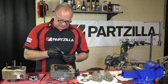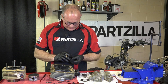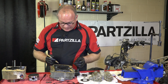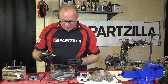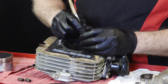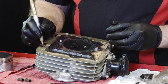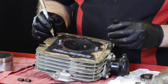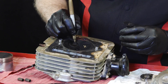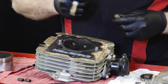Something I should mention before I pull the rest of these valves out — they are looking so good I can pretty much assure you that I'm going to end up putting these right back into the head. So before I pull them out, let's go ahead and get them numbered so they can go back to their home base. Let's make a little mark here and here. Of course your exhaust and your intake are a different size, so you can just go 1, 2, 1, 2. With that done, we're going to go ahead and get the rest of them pulled out.